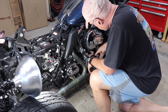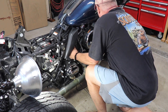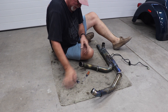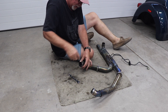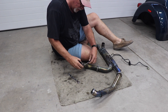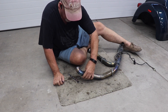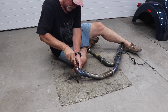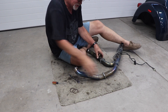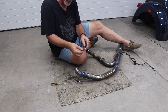We work the pipe from front to back to get it out. There are a couple things to take off the old pipe. First there's a slip ring — put a little screwdriver underneath it, pry it up and over, and pull that off. Do the same with the other one because we're going to reuse these. Then pull the flanges off — they have an indentation where the slip ring fits in.